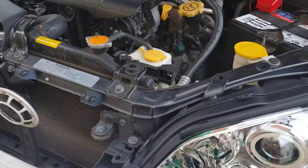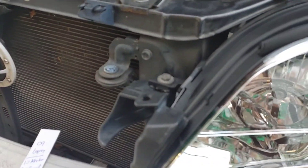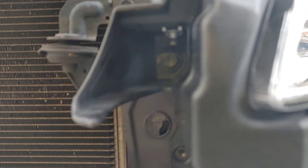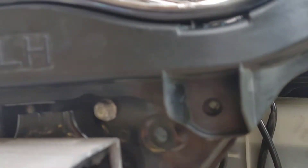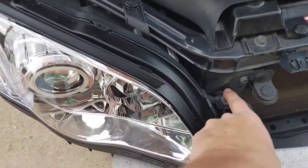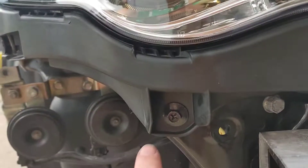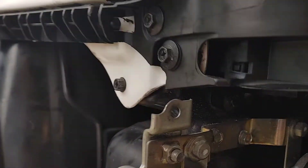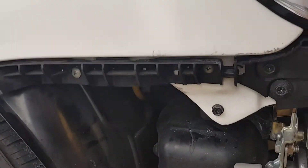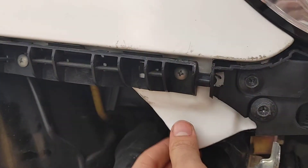These whole brackets didn't come with it — you have to install them. It's as simple as sliding in the headlight and then doing this bolt right here, then there's a bolt up in there and a few bolts underneath. Starting from the top, this one solidifies the headlight in the housing. Then there's one back in there, one down here, and the middle one — these two right in here help attach the headlight housing to the fender. Down under here you've got one right there. On this side, you've got to make sure these two line up — there's a screw and a screw, and then these kind of pop in and you're all good.